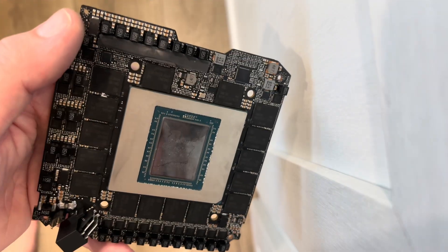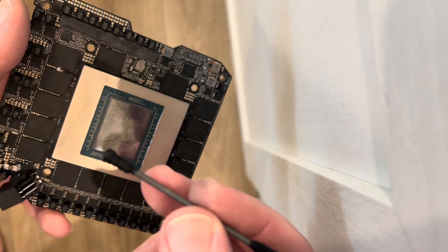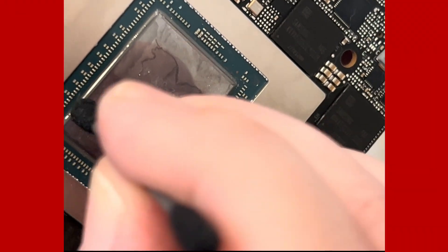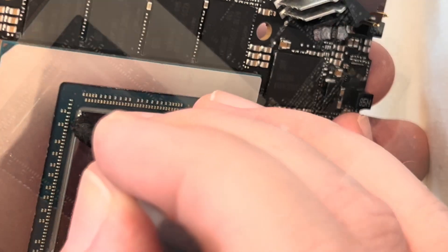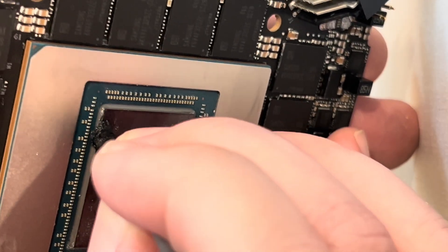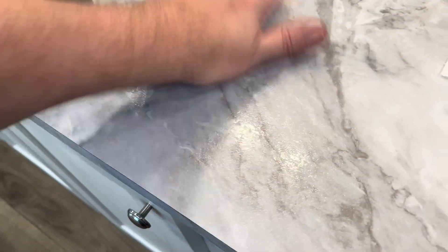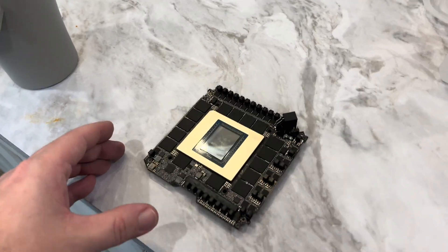Use a paper towel to wipe liquid metal — they're literally one-time use. When you wipe, there are going to be tiny little beads of liquid metal everywhere; you're going to have to remove the paper towel and get another one. Be careful with what's on your fingertips — wipe your fingertips off on your pants or something to remove any tiny liquid metal particles, because you don't want that stuff splashing on your board. We're just carefully running around the edge with an alcohol q-tip, running across the edge to collect it, then wiping down with alcohol.